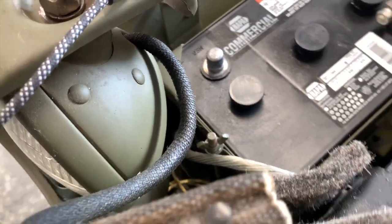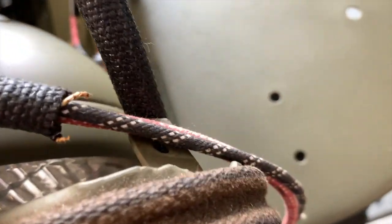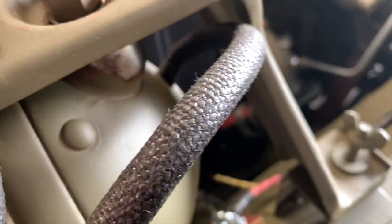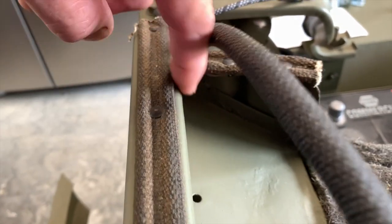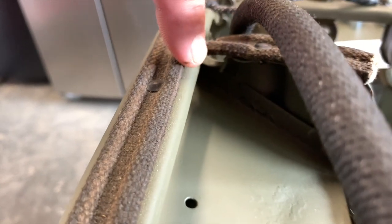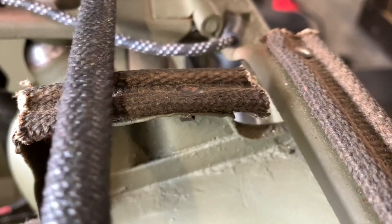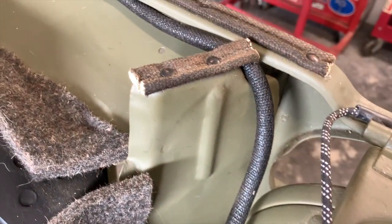If you've been following the Team G503 videos up to this point on the wiring, we are at the point now where we can connect our headlight wires to the two-post block that's on the inside of the fender on the driver's side. I'm showing you the long side and the short side — the long wire comes from the passenger side, draped across the grille, and the short one goes on the driver's side. I don't have this placed in the correct area yet, which goes behind this little bracket, then underneath the grille, attached with clips.